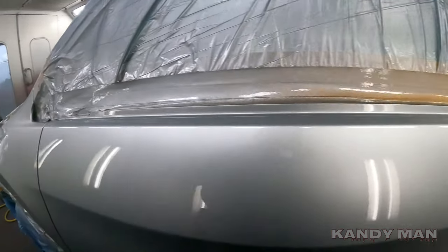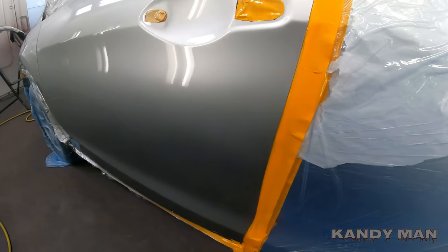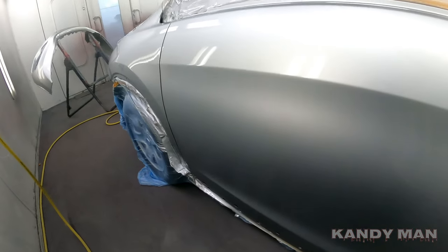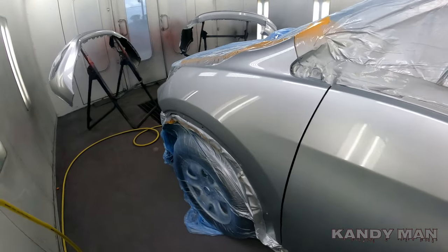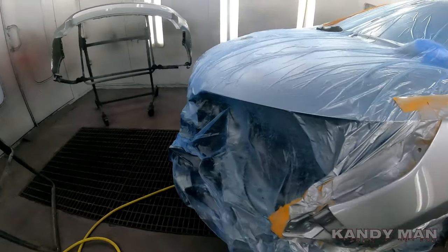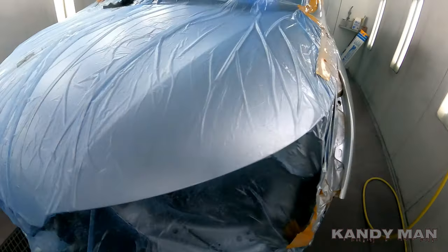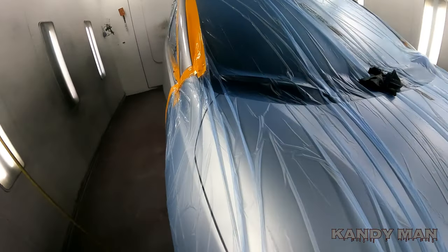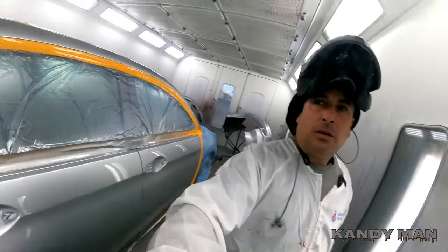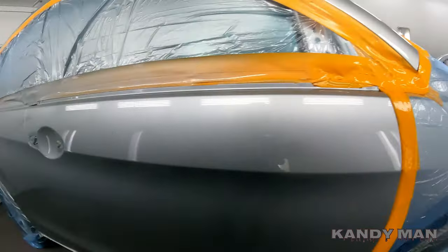So there it is guys — all finished up, looking good, looking clean, blend looks beautiful, nothing on the back of the blend. And that eliminates the need for base clear by just giving it one quick little sand down with that 2000 grit and knocking down any overspray. This sealer I use doesn't have much overspray as it is, but that's just to ensure I won't fight the color and won't have any trouble — because I don't like getting backed up into a hole and that's what it looked like I was about to do. Thanks for watching this one guys, give it a thumbs up and see you next time.